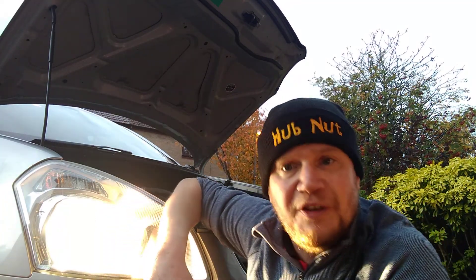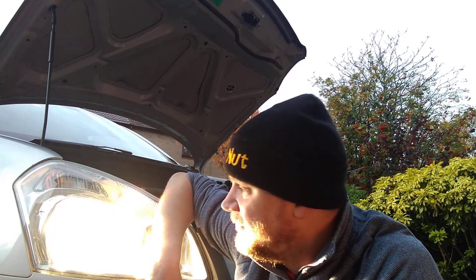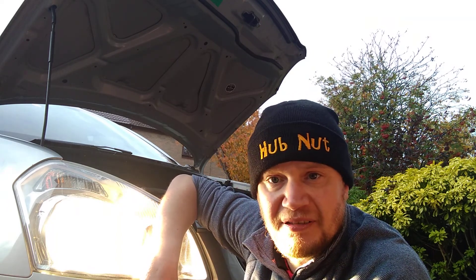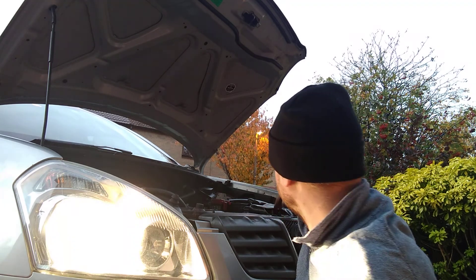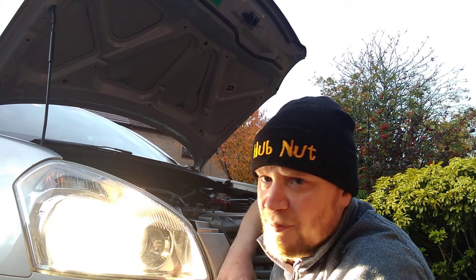I'll come back in the shop. So if you want to spend a couple of hours in the afternoon trying to change the bulbs on your car, then this is a worthwhile upgrade to do. Just remember, the easy solution on this Qashqai — on the 1.6, I don't know about the others — is to remove the air intake system and gain access to the bulb that way.